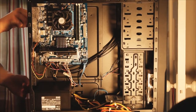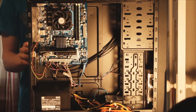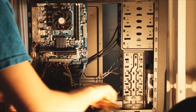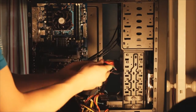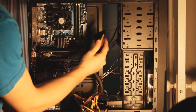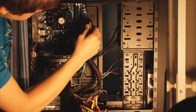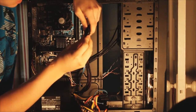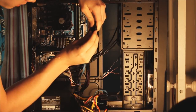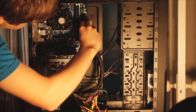Once that's screwed in, pull out the back thumb screws — you're definitely going to have to do some cable management because you can't expect decent temperatures if you have cables all over the place. Pull the back off and start connecting stuff. I connect the 24-pin first. With this case there's not really anywhere to hide it so it kind of just goes straight up. Make sure this little pin is facing towards the outside of the board. This four-pin section comes off because some other boards only use 20 pins, so make sure you have it on and it's tight. Plug it right back in.